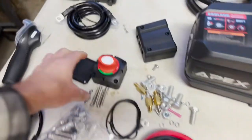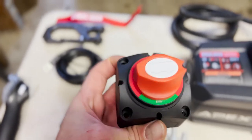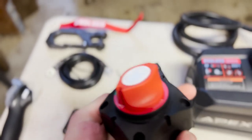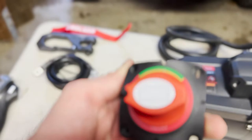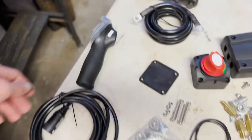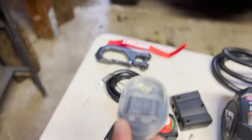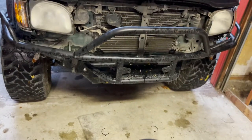It comes with the 50 amp solenoid, which is really nice that they already include this. When you're not using it in your truck you want to definitely have the switch in the off position so that it's not creating any draw from your battery. Another great feature — I have one on mine out there — I'll show you how it's mounted. Mine's mounted a little bit different, feet first.